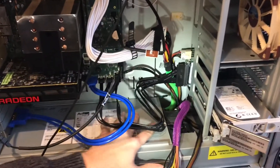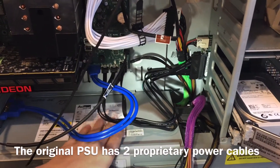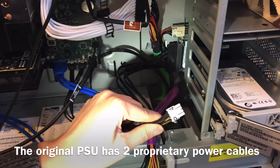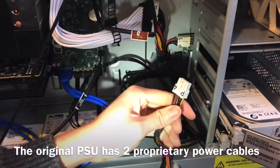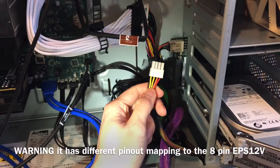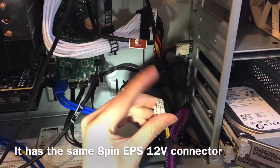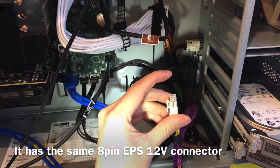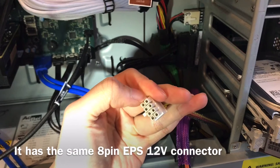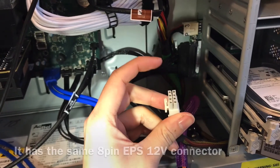This is the power supply that came with the original Sun Ultra 40 and 45. You can see it comes with two cables — this one denoted P4 and the other S1 P3. They have a proprietary power cable with a special layout pinout. However, I want to point out that this connector is exactly the same as the EPS 12V 8-pin connector, which is good news. It's not a proprietary connector, which comes in very handy if you want to create an adapter or modification to use a standard ATX power supply.